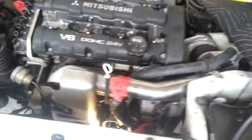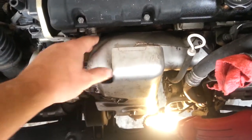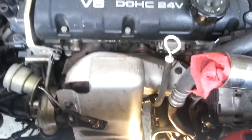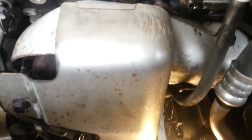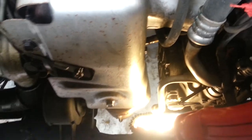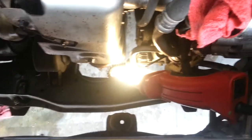You can see the radiator has been pulled, so now I can get the shield off the exhaust — something else that doesn't seem to be on a lot of cars anymore. Right there by the dipstick tube you can see the O2 sensor. Once I get the shielding off I'll be able to get that removed. I've also PB Blasted all these nuts and bolts and the O2 sensor to get them soaking.